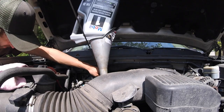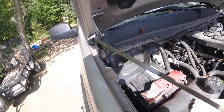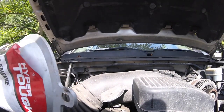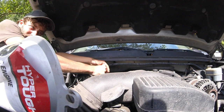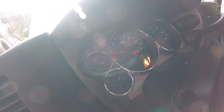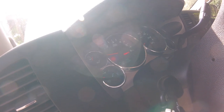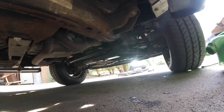That's been draining for a little bit, so let's check it one more time. Those little holes on the dipstick hold the oil so it doesn't just have to stick to metal — that's how you can see your fill level. We are right at the top, and that is with five quarts. I have a feeling it might take a hair more. Now that I know it's full, let it run for a few minutes and then we'll check it again. Now we're going to start it up. Watch your oil pressure gauge — it should go up to around 40 or 50. That one second where it took to build oil pressure is why I filled the oil filter up — so there's residual oil in all the bearings and you give it the best chance to get oil up there. Let that run for a minute and then we'll check the oil. No leaks.